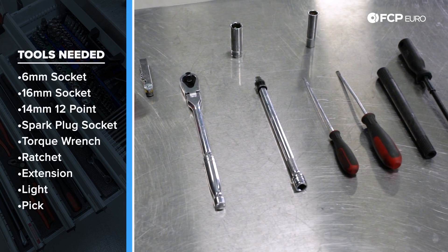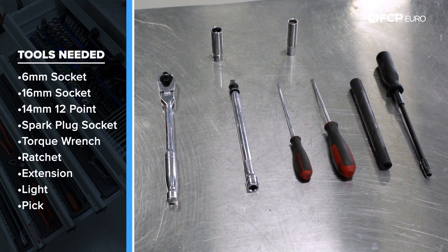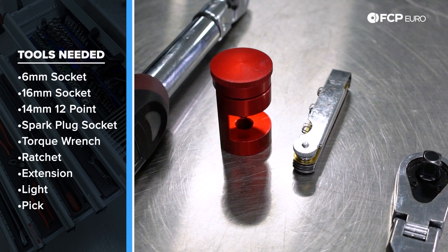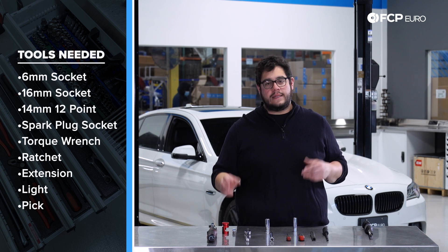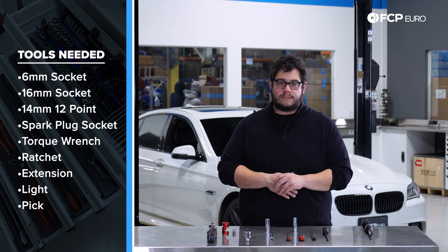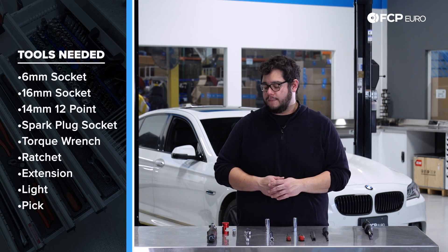For this job we're going to need a couple of basic tools, starting with a torque wrench. A spark plug gapping tool as well as a feeler gauge — this one from Torque Solutions is nice. You feed the spark plug into it and you tighten it down to get it to size. That is only if you're going to be changing the gap from the original OE specs. This car is tuned so it's going to call for the 0.56mm gapping.